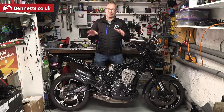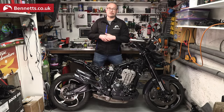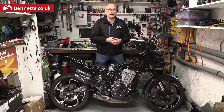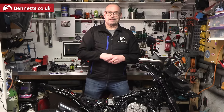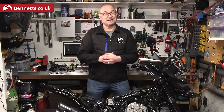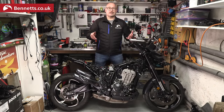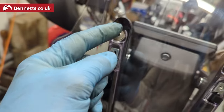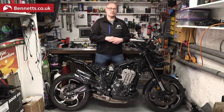A bolt had a little bit of rust on the thread but that's more to do with it being exposed underneath the nose. I sprayed this with XCP when I got it and I've been riding it through the worst weather in January, including Storm Henk, and there's been some serious salt built up on these oil cooler pipes. There is some marring to the surface — the lorries have been gritting pretty hard every night so it's no surprise — but that marring is no different to what I've seen on Japanese bikes. There's also some rust on one fastener on the screen.